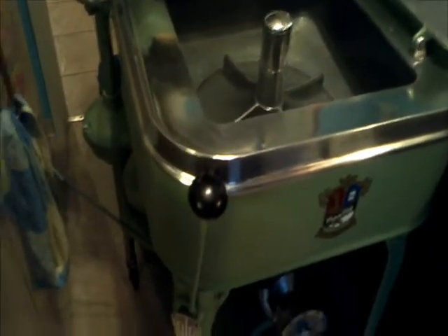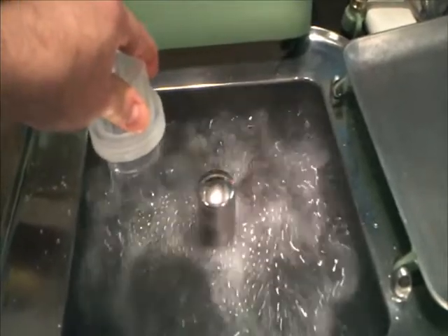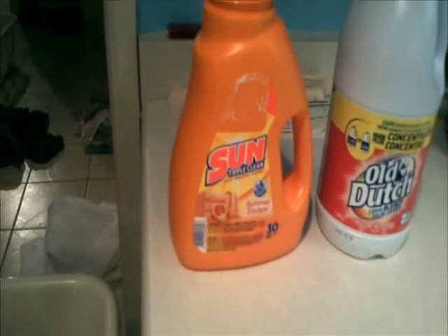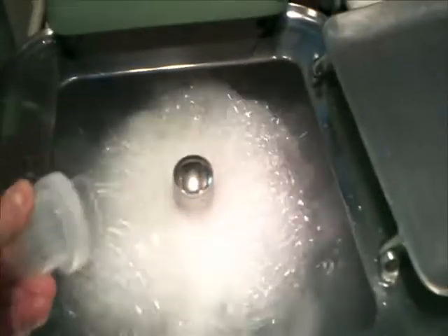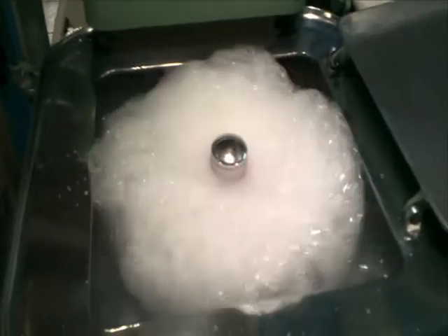The next step: plug the machine in, because there is no on/off switch on a Maytag. That will get the motor going. We'll then engage the agitator, which is done by this lever here, pushing it over, and the agitation begins. At this point you add your laundry detergent — either powder or liquid as you prefer. I tend to use liquid and a non-oxygenated detergent, for example Sun Triple Clean. The aluminum will badly darken if you use any oxygenated detergent or bleach. Once that's dissolved we'll start adding the clothing. This is a crucial step: you never add your clothing and then the water — it's always clothing after the water and detergent, so you know the proper load.